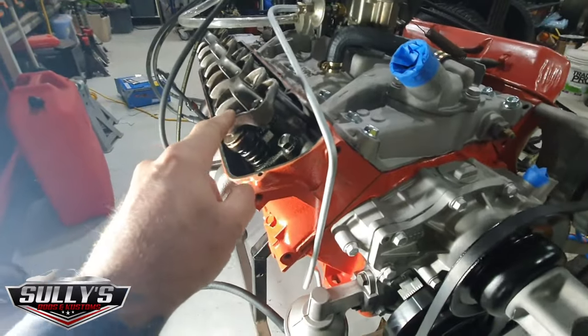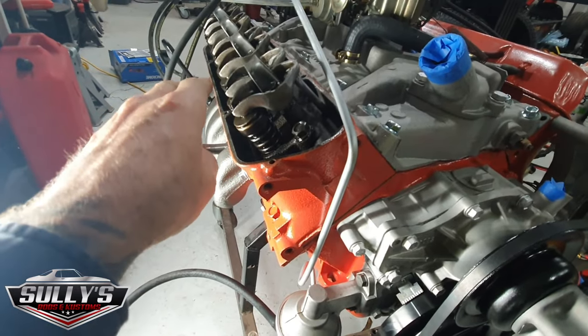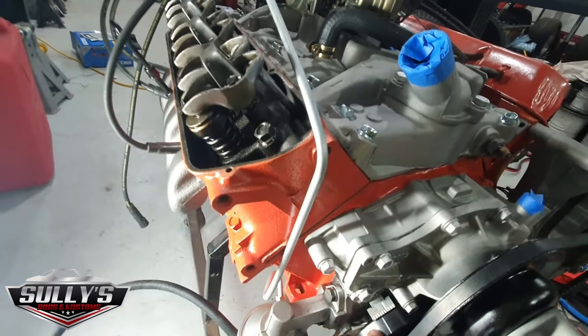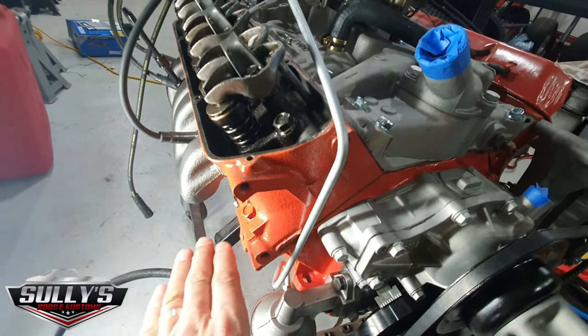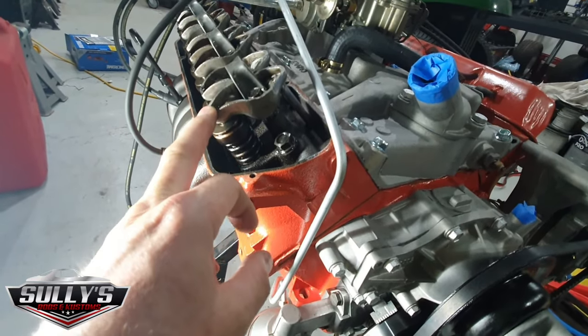As I rotated it over, I watched the valves rock. As the valves rocked, I seen the exhaust valve go down and come back up. And then I watched the inlet valve go down and back up. And when it came back up, it was pretty close to top dead center. So I knew that as it was sucking fuel in through the carburation system, that valve was open.